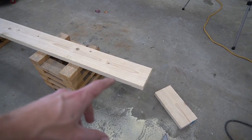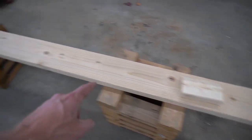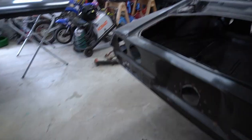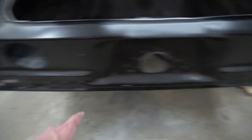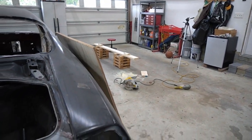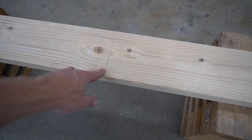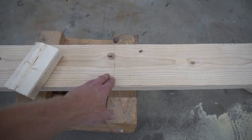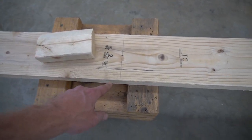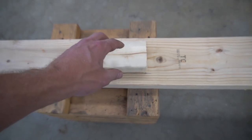This piece is 84 inches — it's the 2x6 that's going to run across where the bumper would go. Next we're going to put the standoffs onto this 2x6. To do that, I'll measure from the center of those holes to the center of those holes and transfer that over to the 2x6. Here's the center of the board, and then 22¾ inches this way marks the center for the standoff — same thing on the other side. For my car, measurements come up an inch and a quarter. We're going to put a screw in to hold it in place, then drill through and put bolts in later.